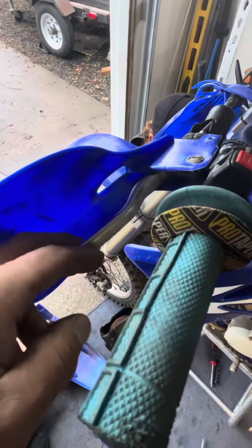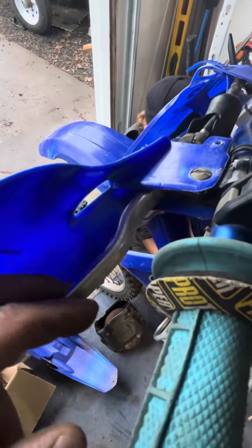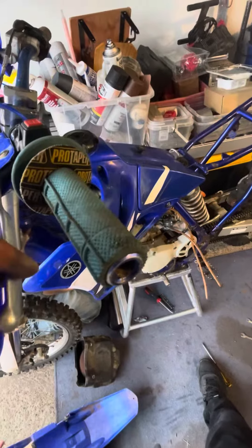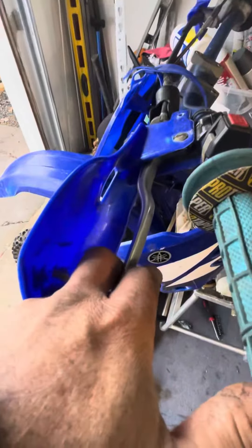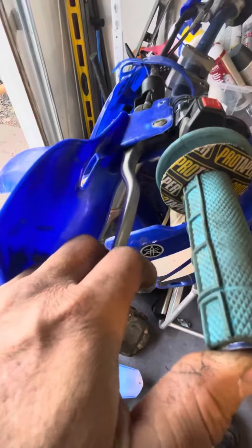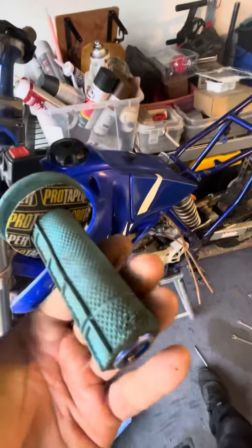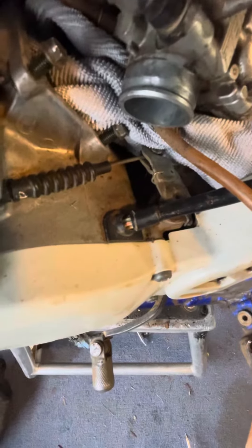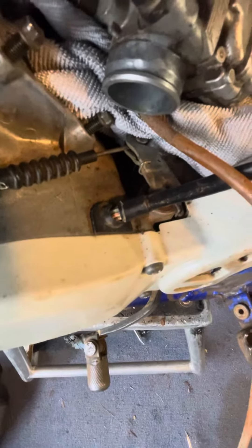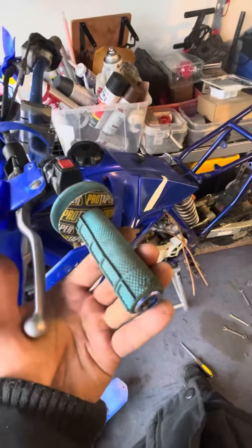Now up here, you'll notice it's loose and it has just a little bit of play. So right here, nothing's happening with any pressure — it's not pulling anything. You'll see that it's not moving now. So you can wiggle that in and out and it does not move the clutch arm. That means it's relaxed. At the point where this play leaves and you start to push on the clutch with a little bit of pressure, that's when you're going to notice it's just slightly moving down there. Right past the wiggle point, that little bit of play — it's just touching the clutch plates right now.